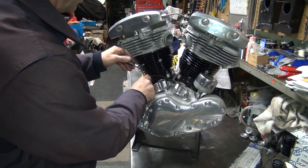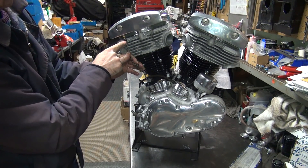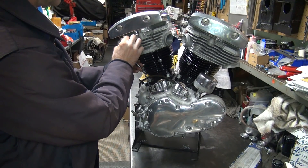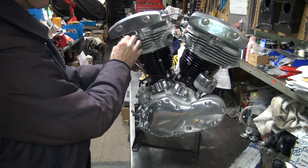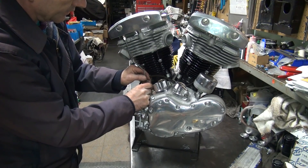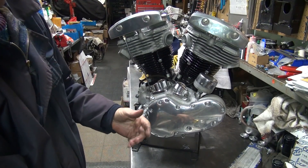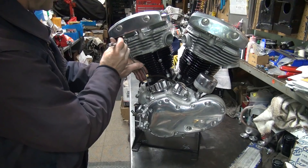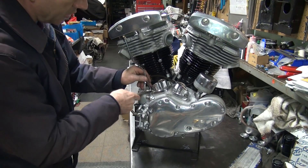I've got this one here, and this one just barely fits. What I do is slide the O-ring up here a little bit so I know how much engagement I'm going to get. Bend the line slightly to get it in there, then lift it up to put it in. Bend it so it goes straight and that will go in easier. Lift this one up, shove the rubber all the way down, and this one will go in. Try to make the tube between each rubber a little bit centered — if it's all over to one side the tube can slip out, leak oil, cause all kinds of problems. When you tighten these down, do them equally because compressing the rubber will slide the tube one way or the other.